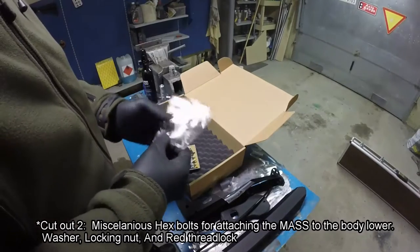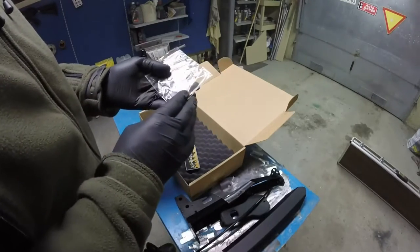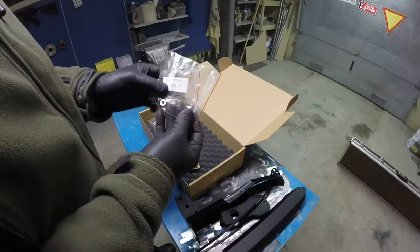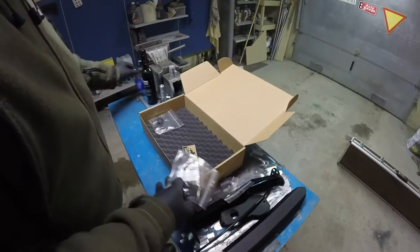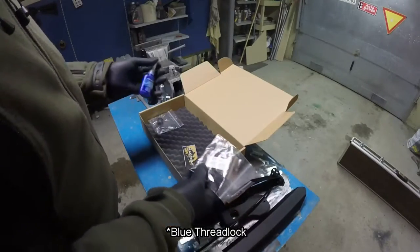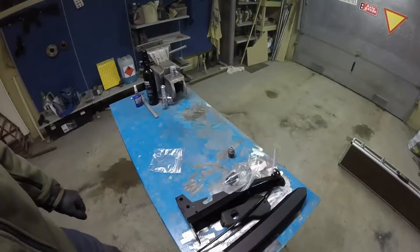miscellaneous screws. I would not recommend using red Loctite since it is very heat resistant and doesn't need to be in this kind of install. If you ever want to take it off, you would need heat from a heat gun to unlock it. So I would recommend blue Loctite instead, whatever brand, Permatex or otherwise, because it's not as strong as red.